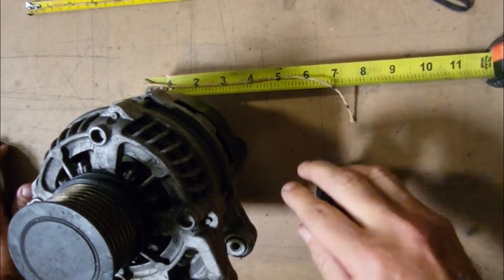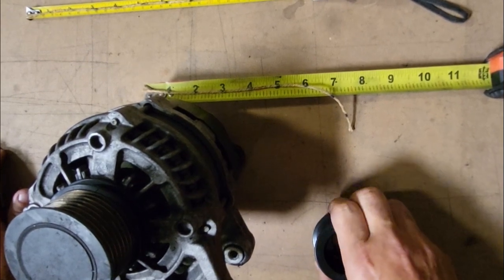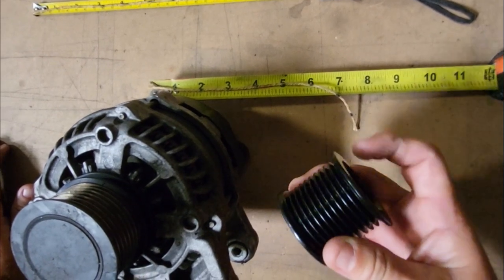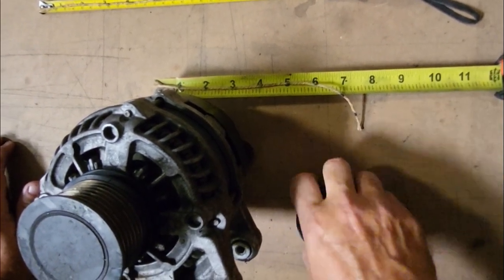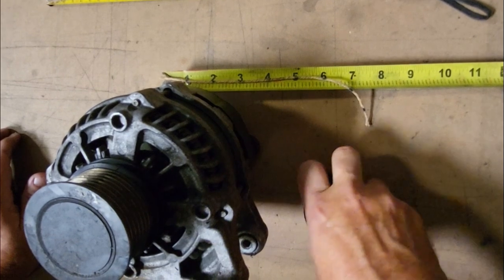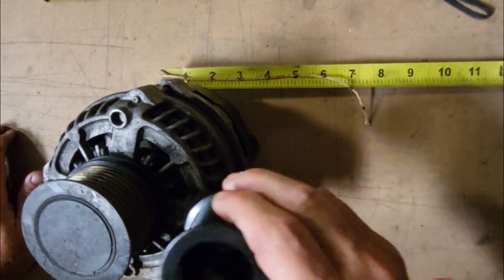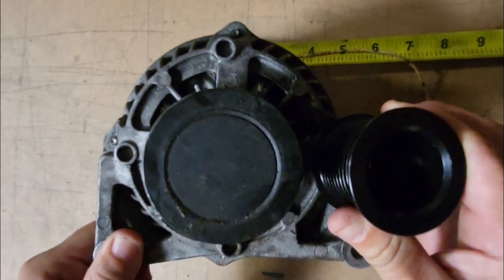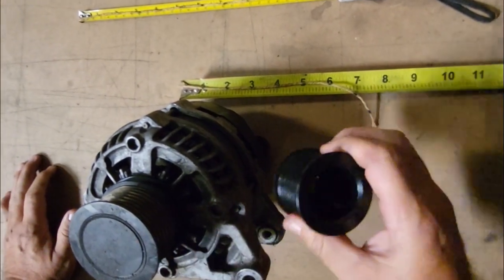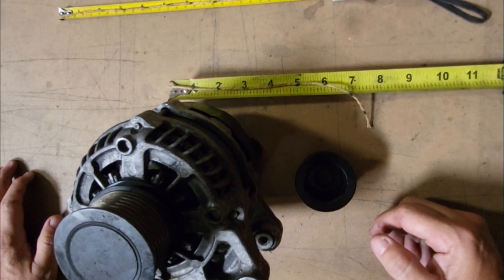That's a 2-inch difference. So if some of you are thinking on this particular application that a half an inch shorter overall belt is going to work, the answer is no. There's a difference of 2 inches there. We always say make sure that belt is tight — half an inch on average — but here's an example where it is about 2 inches shorter overall length. So if this helps you figure out what shorter belt you need for the difference in diameter, by all means use the string around the pulley. It'll at least get you much closer to the right tightness than just guessing it's only a half an inch shorter.